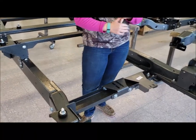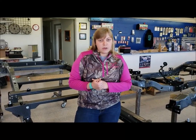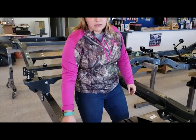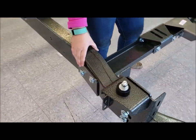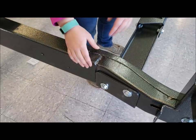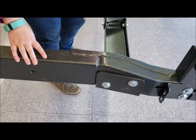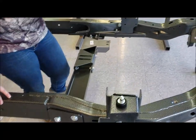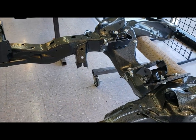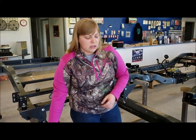For example, if you've got an LS engine that you're using a 4L80 style transmission with, you're going to get different sets of side saddles. With those side saddles, they are not going to be mounted like these. They're actually going to be mounted somewhere behind the factory seam in here. And with those, you're actually going to mount them where you see fit — get your engine set down in there and mark off where those side saddles would go.